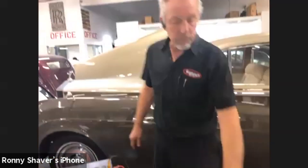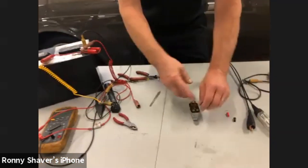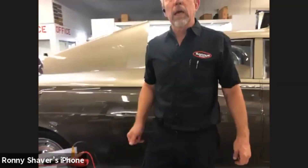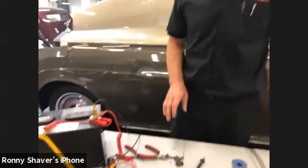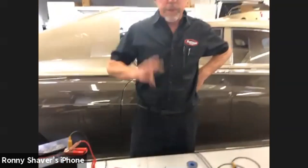On the Shadows, especially the Shadow IIs, they use three of these relays to make the windshield wipers work. You have normally closed and normally open ones and they all have a job — every wire is connected on every one of them. A lot of times the wipers won't turn off; sometimes they'll get stuck. First thing I always do is just swap the three relays — put all new relays on and see what happens. Nine and a half times out of ten, that will fix the problem.